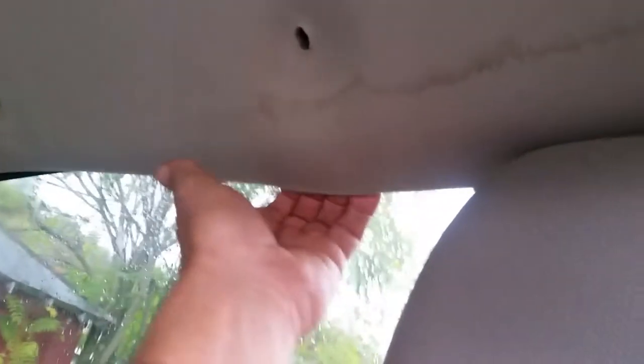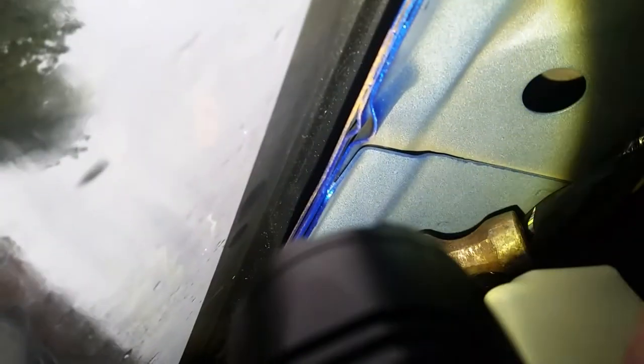You can see it right there around that window seal. If it was leaking around that light, there are a few places in the back here that have gaps in it. I pulled this headliner down and you can see up in there — it's not leaking there, it's actually running right out here. There's a place it should be leaking out if it was the light, but no — it's definitely leaking around this window seal back here.